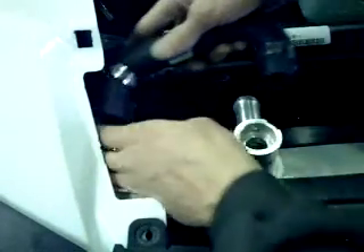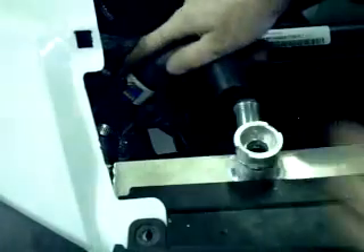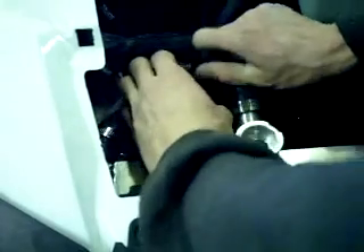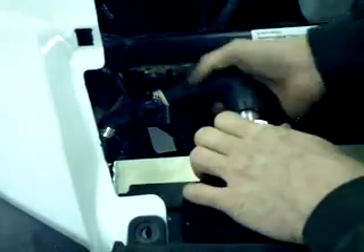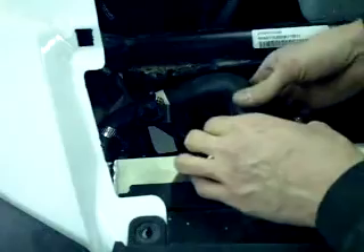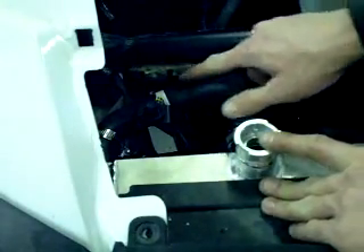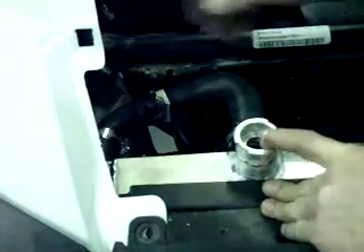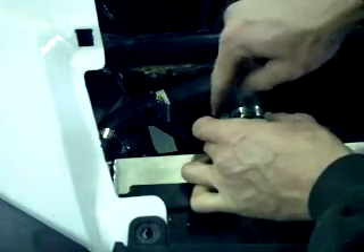What you need to do is put your hose clamps on. Go ahead and put the short side of this hose to the tank side and the long side to the filler neck. You have to slide that on all the way. When you put this on, make sure that it's not rubbing on the frame here, and also that you're not rubbing on the plastic fan shroud. Make sure that you've got plenty of clearance. Adjust your hose accordingly to where it fits without rubbing, then go ahead and tighten up your hose clamps.